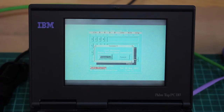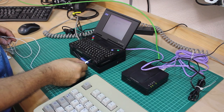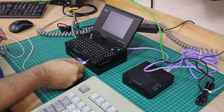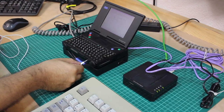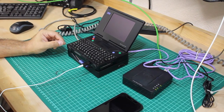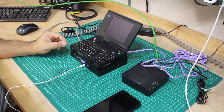Let's see if we can achieve the same in DOS. I use Dialog 2.13, a CLI-driven phone dialer for DOS, for my test. And yes, after all, it seems to be working as well. Interestingly, the humming seems only to affect the outbound direction — anything picked up by the IBM's built-in microphone. A headset would help here, though that's not straightforward: a standard 3.5mm plug would not work, as the Palmtop PC features only 2.5mm jacks. I did have an adapter, though not the correct one that passes both audio-in and audio-out lines, so I couldn't use the microphone of the headset as a result.